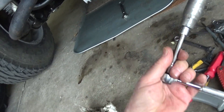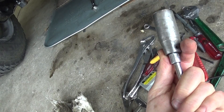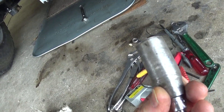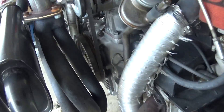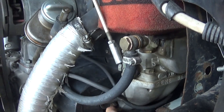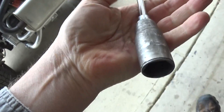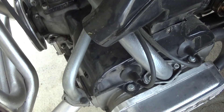Here's a spark plug wrench. When you run dual carburetors, it can be very difficult to access your spark plugs. Here's an example of a socket that I just ground up to make it go in where it needs to go. Look at the difference — getting this spark plug wrench on when you're running dual two-throat carburetors like these Webers makes it harder to get in there. So I just get an old wrench and grind it off. You don't have that problem on the single port because there's just a lot more room.